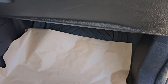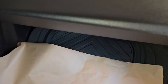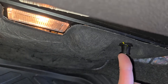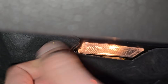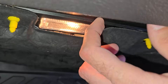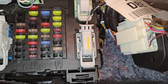The fuse to check will be in a small fuse box which is in the passenger's cabin under the glove box. I'll turn the flash on my phone so I can show it to you better. The first thing you have to do is remove the bottom cover. To do that, you'll have two black plastic screws, one here and one on the opposite side. Just unscrew both of them and pull the cover all the way down — then you'll get access to the fuse box.